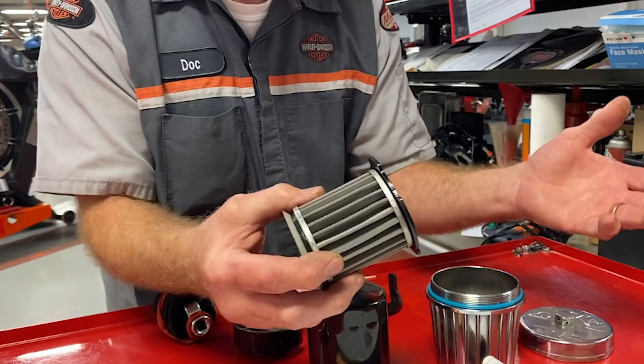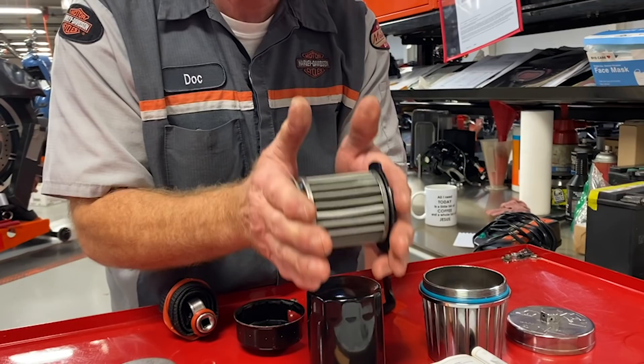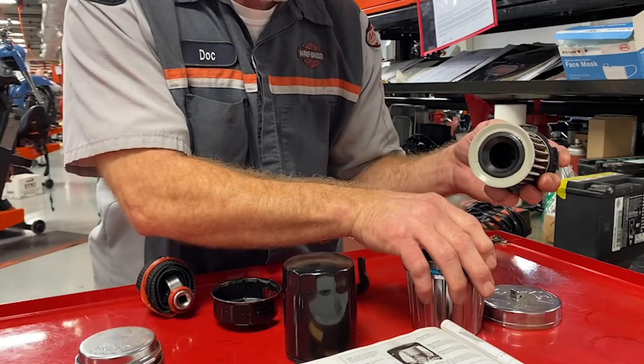I can't tell you if this was a motorcycle one — I believe it was an automotive one, and that's my concern with you guys looking for the best buy for the buck. You'll find automotive ones, and they are not designed for Harley-Davidsons. One: is the micron small enough? Two: does it fit the sizing of where this oil filter goes?